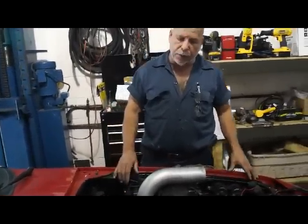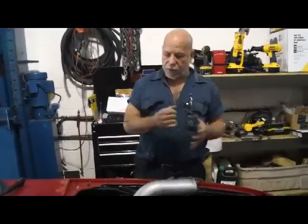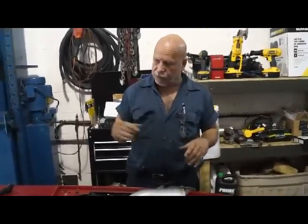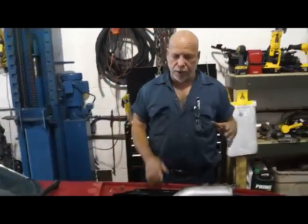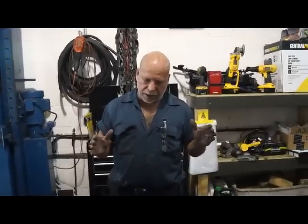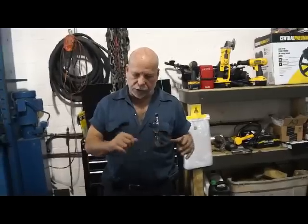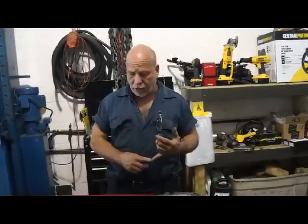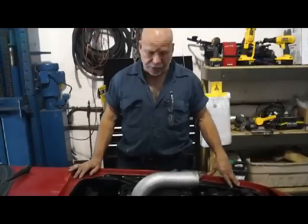The customer decided to put the turbo transmission. That being the case, you have to modify the box where the shifter is in so that it comes out in the same spot as the original shifter on the car, because the turbo transmission, bell housing to drive shaft is about the same, but the shift selector box sits a little bit further back. So that required a slight modification, and it's also going to require a custom-made drive shaft. But besides that, it's basically a drop-in deal.